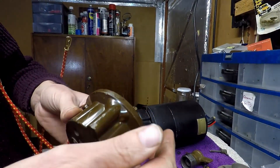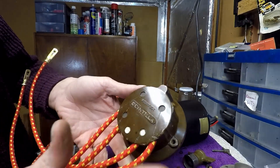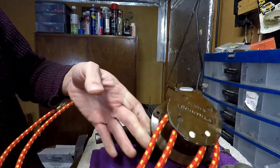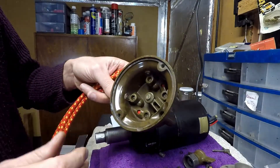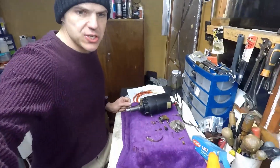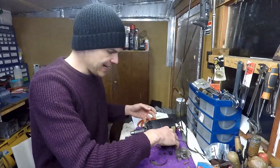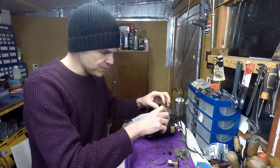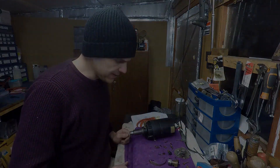I'll show you the cap — as you can see, I've used a little product to polish it a bit because it was very dirty, and now it looks actually quite nice. I didn't want it to look overly restored. As you can see, the leads are quite long, it's got all the leads in, and it's in very good condition now. What I need to do is fit the breaker plate and time the mag properly so that it's ready for me to finish building it.